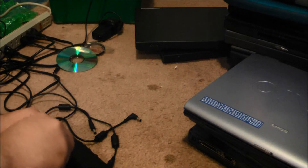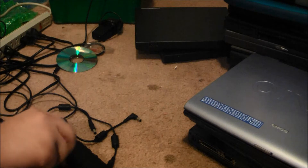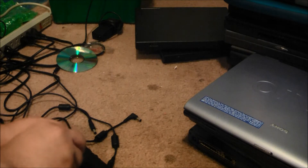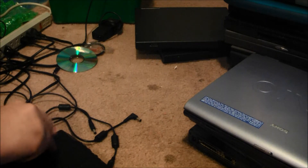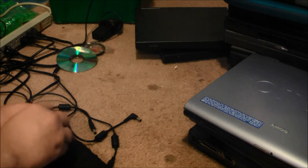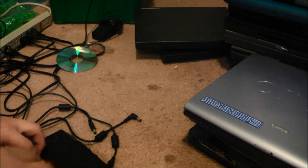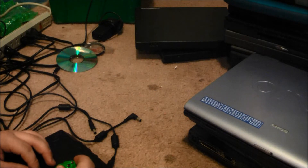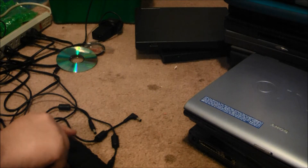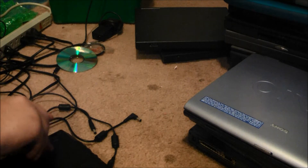Let's just check and see if there's memory. Although IBM should boot without memory — I'm not sure what's going on here. No memory. With no memory it's not going to boot, and it's clicking anyway. Either that or it's a floppy malfunctioning.